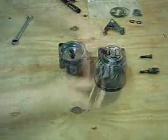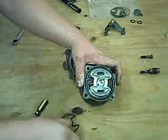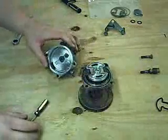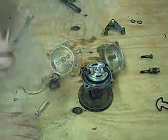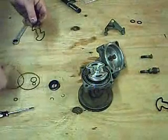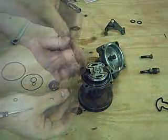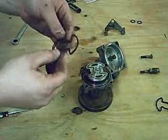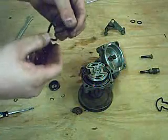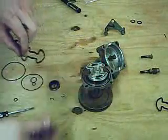Using a small flat screwdriver, gently pry away the inner pump seal. Remove the seal kit from its packing and take out the 2 inner pump seal pieces. A hard plastic piece and a soft rubber lining comprise the pump seal. Place these together. The plastic piece will fit inside of the soft rubber outer piece. Once these are together, place them in the recess in the inner pump plate.